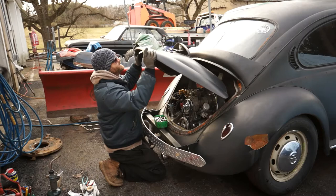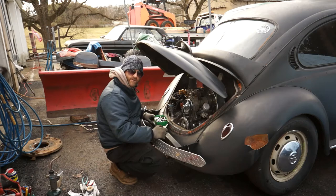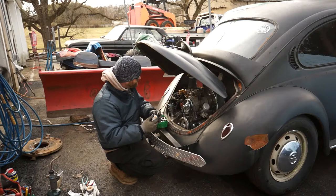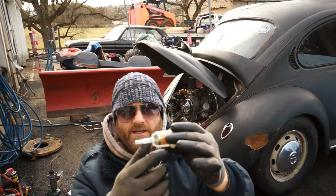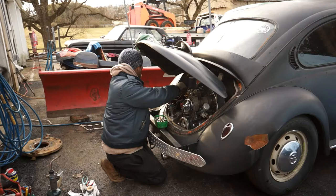I've heard about J Bugs. This fuel filter came in a package in there and I moved into the office to copy down the code number. This is just your traditional see-through fuel filter - you just got to make sure you install it correctly. We're going to swap them out. The fuel filter has a canister and it's see-through. You want to make sure the gas goes up and hits that back plate of the filter - you can see the elements in there - and then it goes out the front. You don't want to reverse it. If you reverse it, it'll still work, but it's better to catch more debris if you install it correctly, with the filter side facing the way the gas comes in. It looks like they've got seven millimeter clamps on here, so we're just going to undo those and take this fuel filter out.